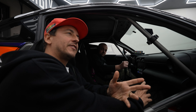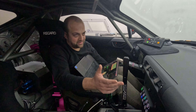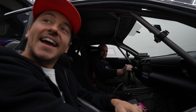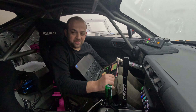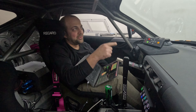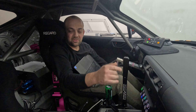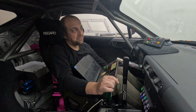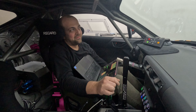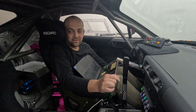The 900-series stuff we're running — to make around 900 to 1,000 horsepower, it's probably going to need 30, 32, maybe 35 pounds of boost. We're glad we brought the wastegate springs because we might have to change them. The motor is a 3.4, so we'll see what it makes with these springs maxed out — should be able to hit about 22 to 24 pounds. If we ran it all the way to redline on this pull, it'd probably make around 475, so if it's almost 500 on seven pounds, it might not even need that much boost to reach 900.